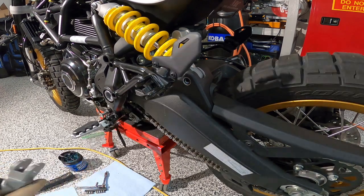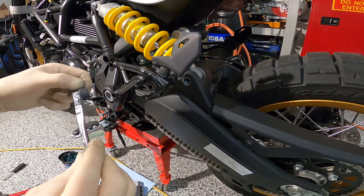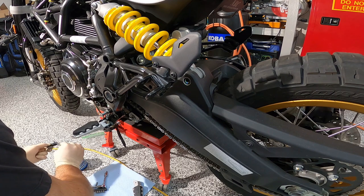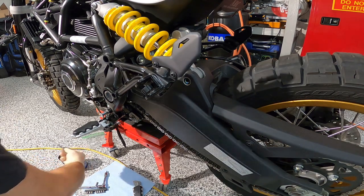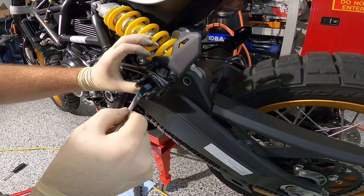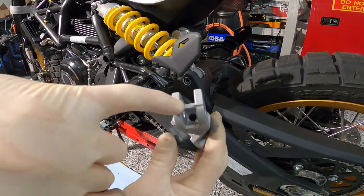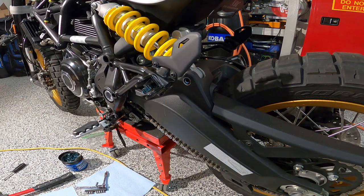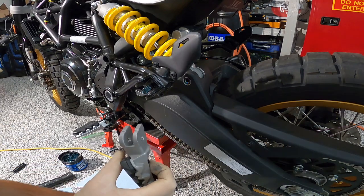And then I'm gonna put some lube on either side of that, just to make sure that we don't have any binding, it's all smooth. Put some more on there. And then I'll put some on the face of it as well, because the ball rubs on the face, so you wanna have some lube right there. And those guys. Now, big key thing here, you got a hole in there, so you drop your spring in. Oh crap, it fell out and now it's bouncing everywhere. Okay, so you drop your spring in here, get in your hole.